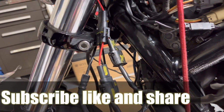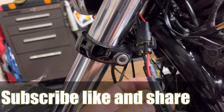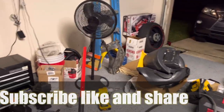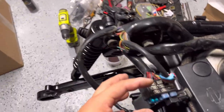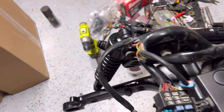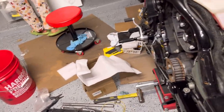You have an option to use the extension that comes with the kit. Just make sure the light color is matching so you're not gonna blow a fuse. If you do blow a fuse, it's gonna be back here — the light fuse is 15 amps, the one in the middle here — and you'd have to replace another one. So we don't want to blow too many fuses.